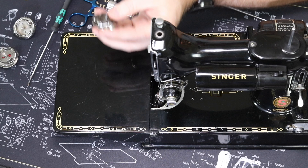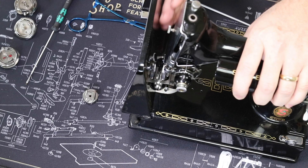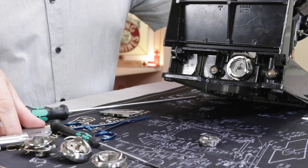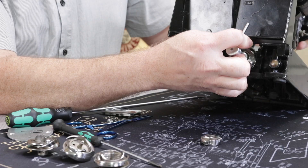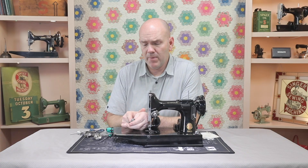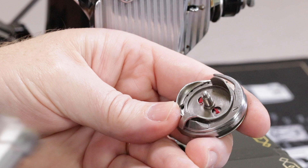So here I'm going to show you again on this machine. If you tip the machine up, raise the bed extension. Now you want to put a towel or something in here so that the bed extension doesn't hit all the way against the screw. Then you take the tool, put it onto the bobbin case base until it locks into place. And then you can either turn the tool here, or in this case you can also turn the hand wheel. With that locked into place — look at that, it's starting to spin — and now we're free. Occasionally you'll get a jam wrapped around the inside. So the first thing to do is take the thread jam tool and get the bobbin case base to move freely.